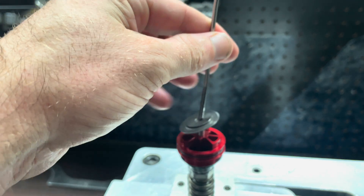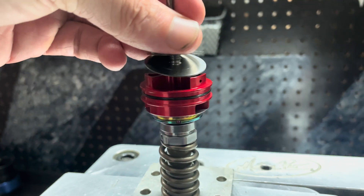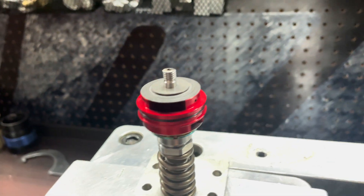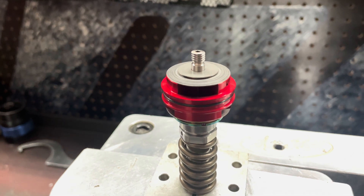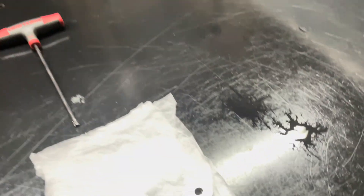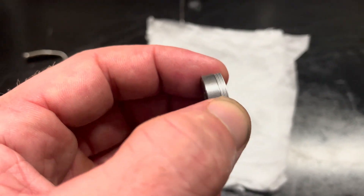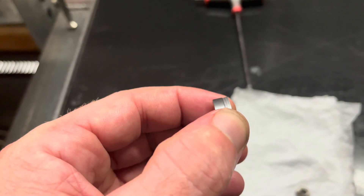Success! Now we have all that on there. I provided you with all these shims, so now we're going to reuse the nut and the original spacer that we took off. This spacer has a few shims underneath it as well, and depending on your setup we may use all of them or only some, depending on the exact height your build came out to.